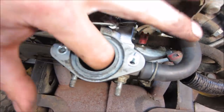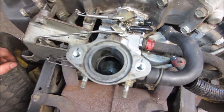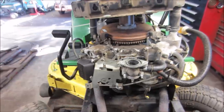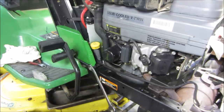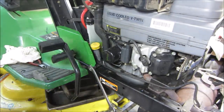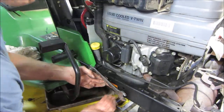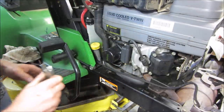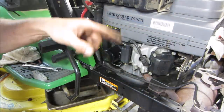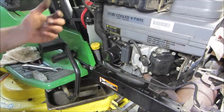Nope, unfortunately it's still doing it. Get all the gas that's in there. That is not good. All right, I gotta go shopping for parts, but again, I'm still gonna put it all back together anyway. So one of the drawbacks of the carburetor over flooding like that is that it depends on what style it is. Some could be just a little bit and it'll evaporate, but some, if the gas tank is higher than the carburetor, it'll just keep flowing and flowing. It fills up the cylinders and then finally gets past the rings and it fills up the crankcase.